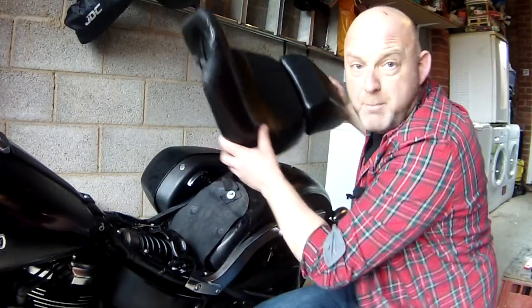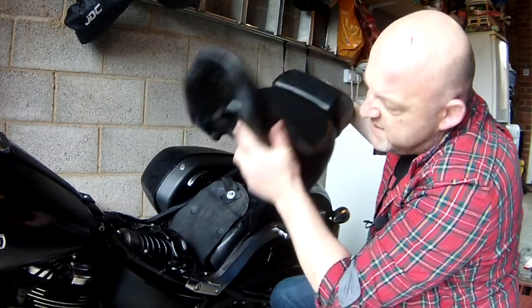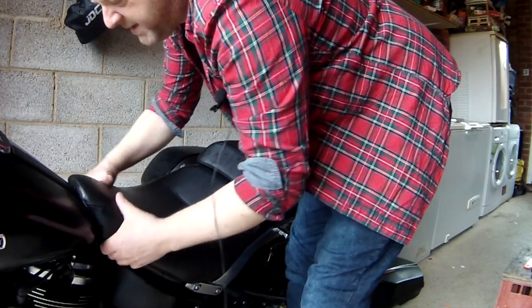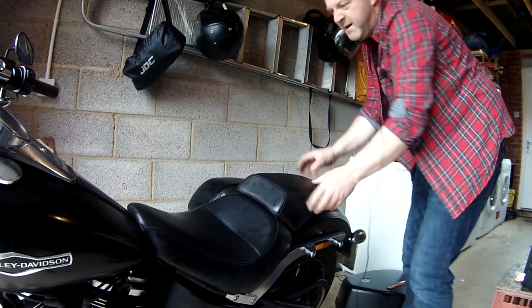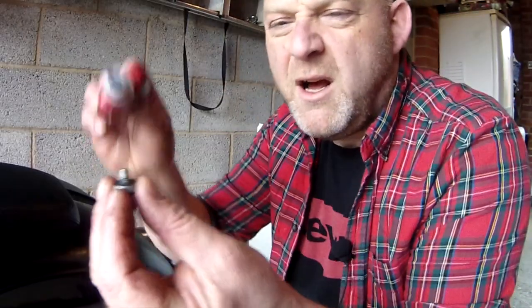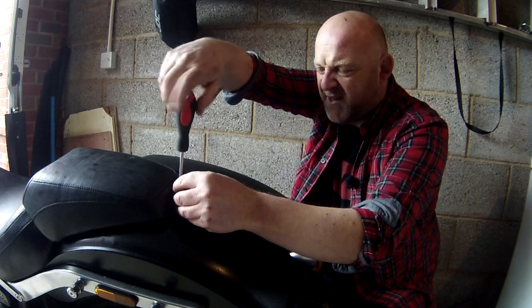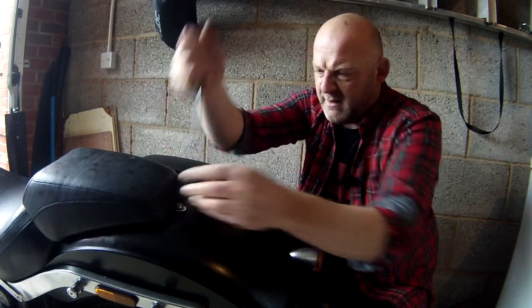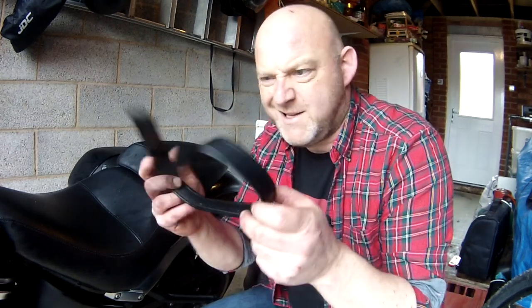Next thing: put the seat back on. Get the seat and pop it back on. Now you've got the tongue on the seat — what you need to do is make sure that it goes underneath the frame rail here. Push it down, make sure it goes under like so, and then this locates here like so. Then just put the retaining nut on the back. Now just for an extra bit of peace of mind I'll put a bit of thread lock on there as well — just a small dab. Then all you do, pop it back in, tighten that up and we are done. So now the seat can come off and on really easily. Just get rid of this strap and you'll be good to go. It makes life a lot easier and there's no risk of damaging that tongue — otherwise that can be an expensive proposition.